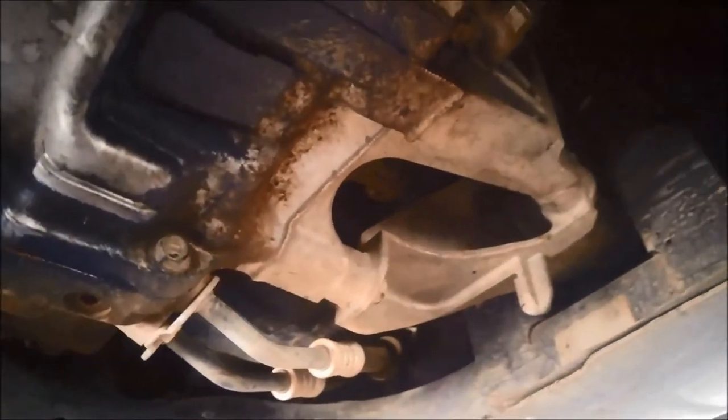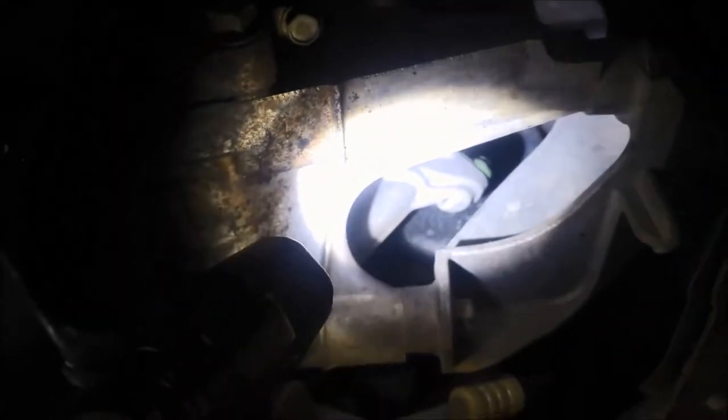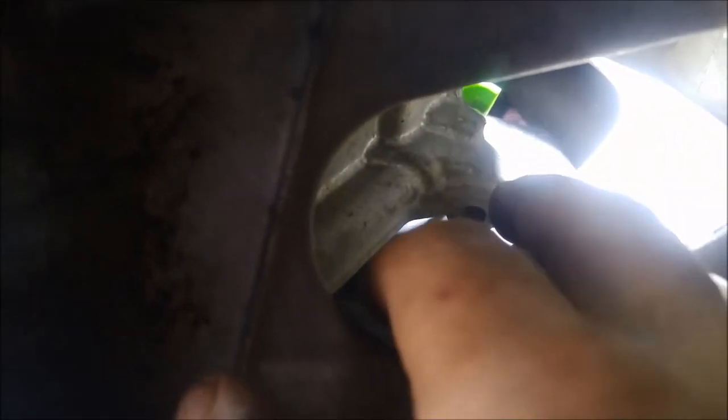Another little thing you might be searching for is where to fill the transmission. Just through here — if you can see that little green plug there, I think there's a little bolt holding it. And that's the filler tube there and the dipstick. A little bit awkward because you've got this bracket here, but I can just barely get my hand through there. The young bloke's hand is a little bit smaller, he might be able to manoeuvre it a little bit easier. 12mm bolt head.